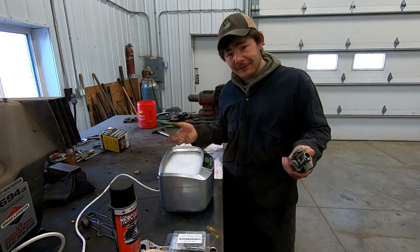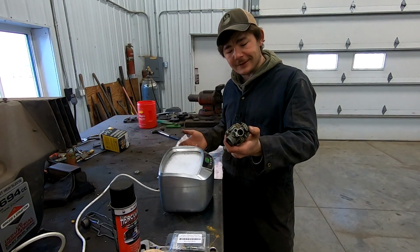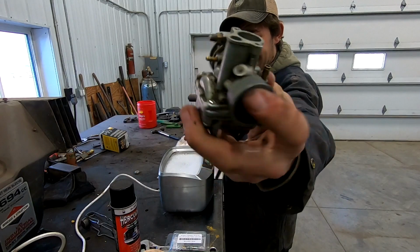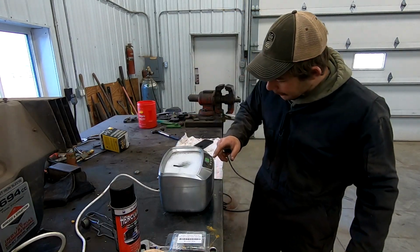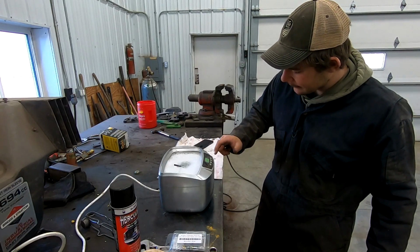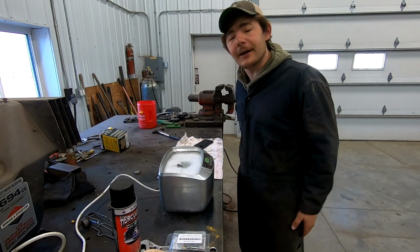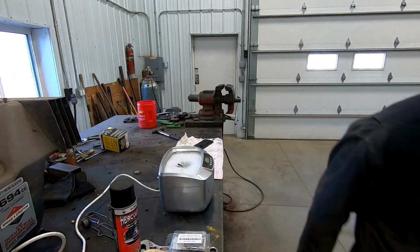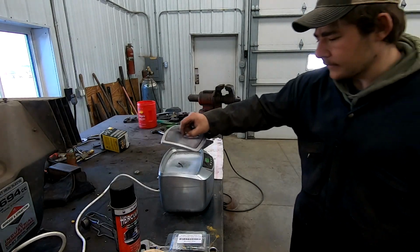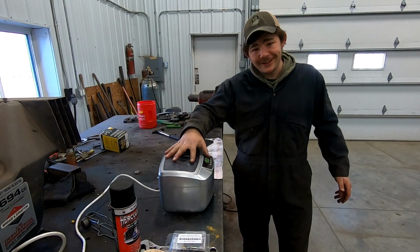And if you haven't used an ultrasonic cleaner or seen them used, they're pretty awesome. You take a dirty carburetor like this, you just dump her in, click the button to the highest setting, turn on the heater, click the on button, and then find your lid. Not sure where that is, but we better find it. Voila, now you just let this bake.